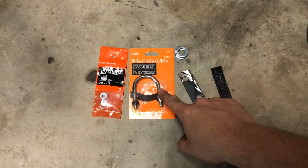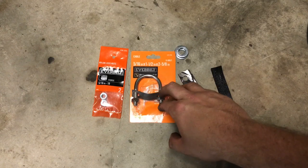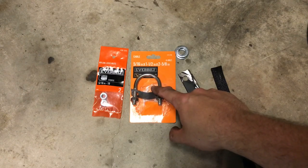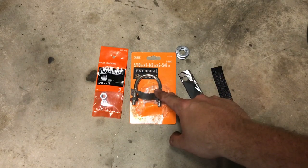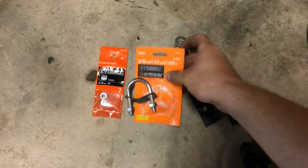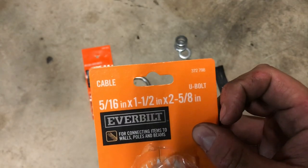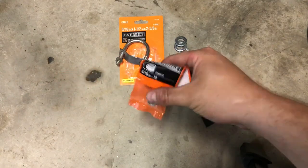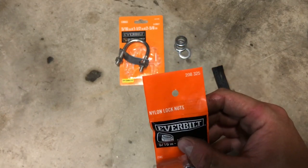The main way we're going to attach this to the forks is using a U-clamp. This is from Home Depot - their stainless steel one. If you get the individually non-racked ones they are very thin. This one has an inner diameter that works - it's just a hair bigger than the EX forks, which are about 1.48 inches in diameter. The model number is 372798, with specs of 5/16 by 1.5 inches by 2 and 5/8 inches.